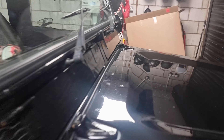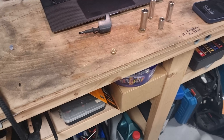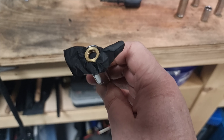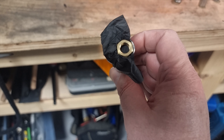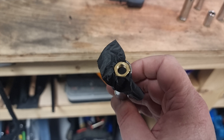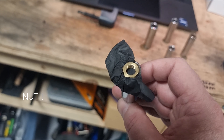I'm not going to be able to show you the next bit because I've got to wiggle the nut on, but I'll show you in a minute. What I've done here is put a bit of rubber glove in the 13mm socket just to hold that nut flush, so I can push it onto the new washer jet and start the thread going — because it's very hard to get the nut on with your fingers in that narrow space.